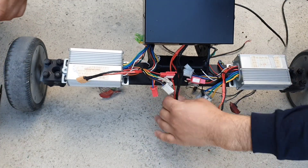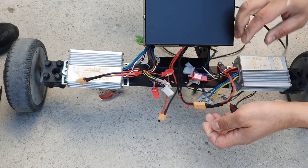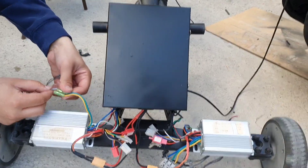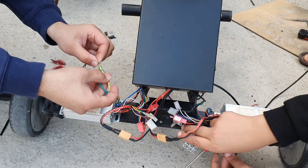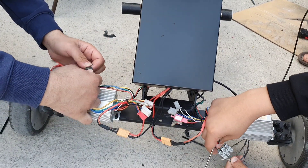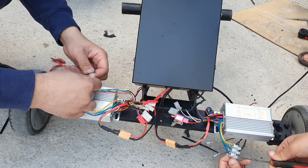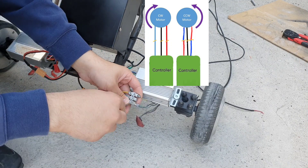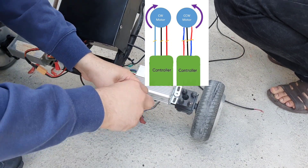With the battery box in place, the next task was the tedious task of wiring the controllers. The power cables were easy, as the XT60 connectors were a breeze to connect. However, the motors used for this project did not have the original connectors for the phase wires, so I had to make do using a connection block. This wasn't too much of an issue, as it did the job really well and the motors are still removable and serviceable. I had to make sure to mismatch two of the three phase wires to ensure that both motors spin in different directions.